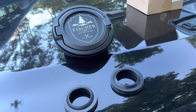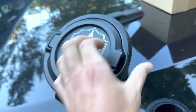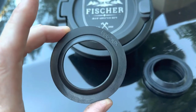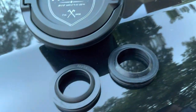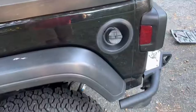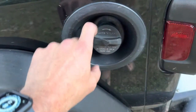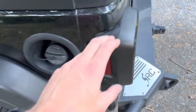The way the fuel cap system works on these Jeep JLs is they've got four tabs on the back which have to be accessed through the rear tail light, and then you have a gasket for the fuel fill. Depending on what size you have, it comes with two different gaskets that fit in that system. Right now Jacob doesn't have a fuel door — he just has a normal fuel cap and the retaining piece — so the first thing we're going to do is gain access to the rear tail light.